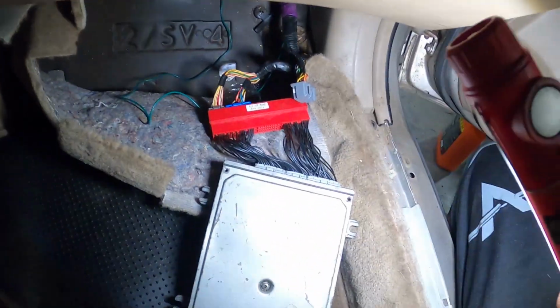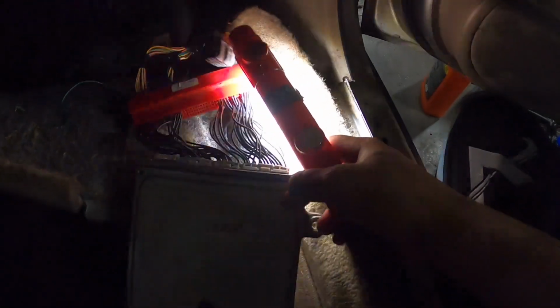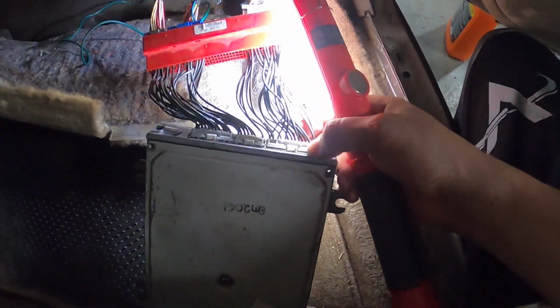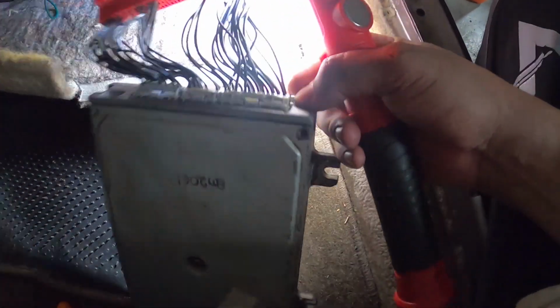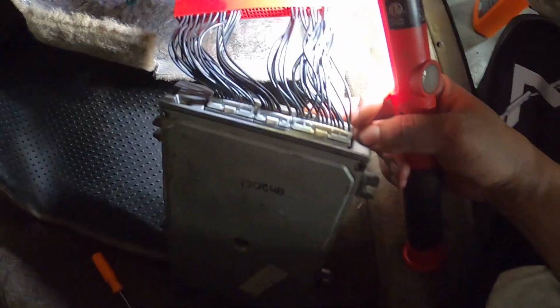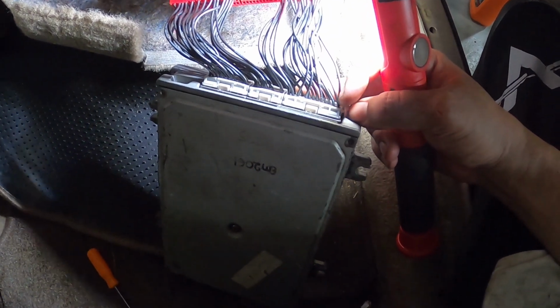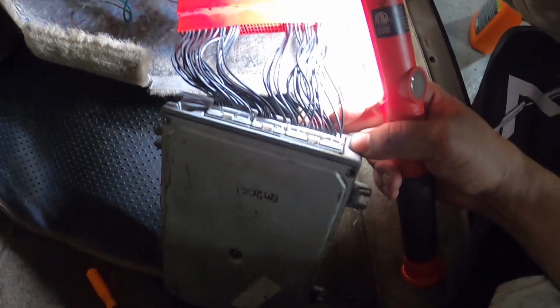So this car is OBD2. So what I had to do was, A4 is the bigger plug here. It's the fourth plug, it's the fourth pin. And the way to count the pins, guys, is like 1 at the top, 2 at the bottom, 3 at the top, 4 at the bottom, like that, right? That's how you get A4.